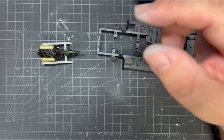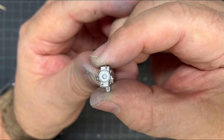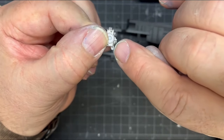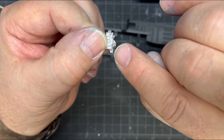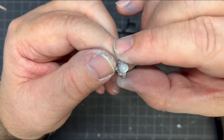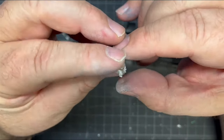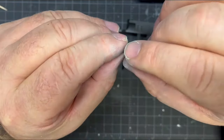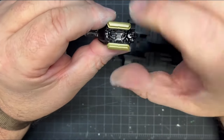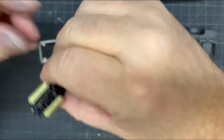I'm really happy with the carburetor. I painted it flat aluminum so far, and I cannot believe they chrome this thing — the chrome made so much of the detail disappear. You've got your little fuel pump linkage in here; our linkage is set up where all I have to do is run a line and a spring on the other side. Our choke looks so good — all I have to do is run the heater hose down across that. I drilled a hole in the front of the bowl for the fuel line, and on the engine I drilled the heater hoses on the top and in the side. I did a vacuum line on the intake for the vacuum advance.